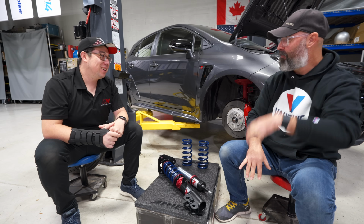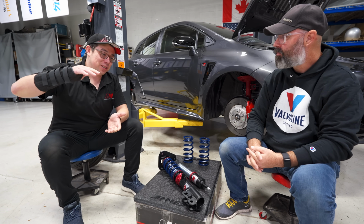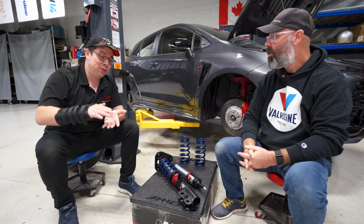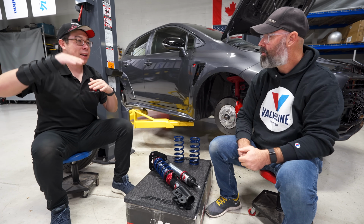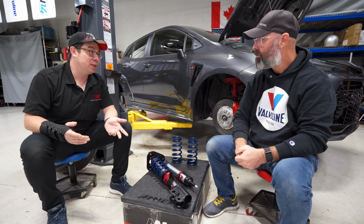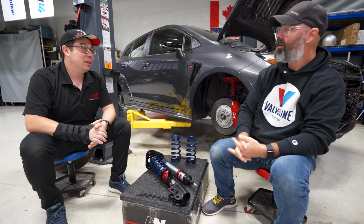And so it creates a pogo effect, like the car is just completely stuck to the road and does not want to let go, but in a bad way. So if you hit a bump, that's where you will see drivers just flying out of their seats. It's a combination of the spring rates that are chosen willy-nilly, as well as the dampers just being rock hard solid. Interesting.